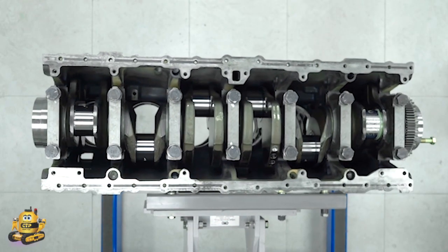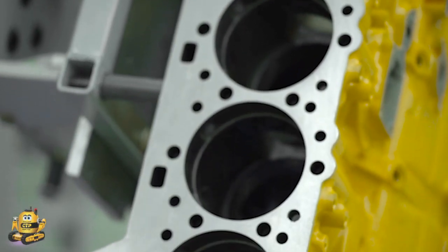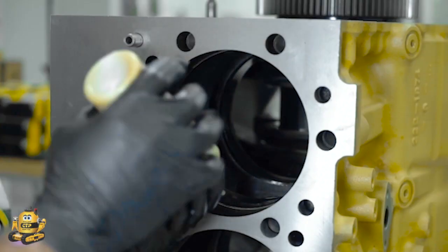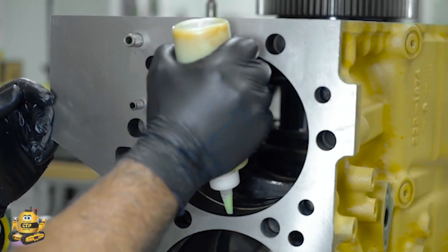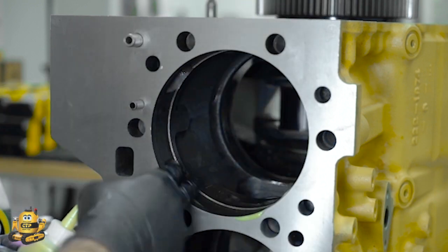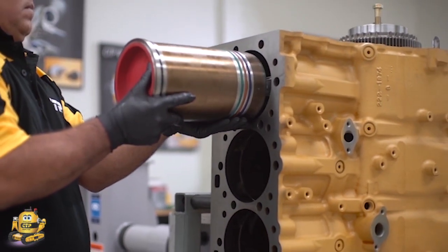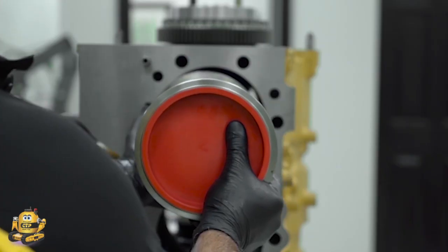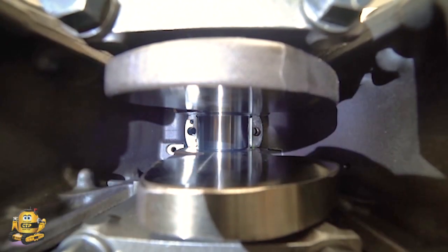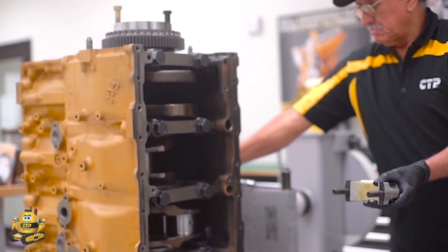We will now rotate the engine block. Normally a connecting rod would be assembled on an engine that sits inside the frame, with the block deck in the up or horizontal position. For this video, to better illustrate the assembly process, we chose to do the assembly in the vertical position. We apply lubricant to the upper band seal area on the block. The technician starts to insert the connecting rod assembly into the engine block. From the opposite end, a second technician guides the connecting rod carefully onto the crankshaft to prevent damage to the rod journal bearing surface.